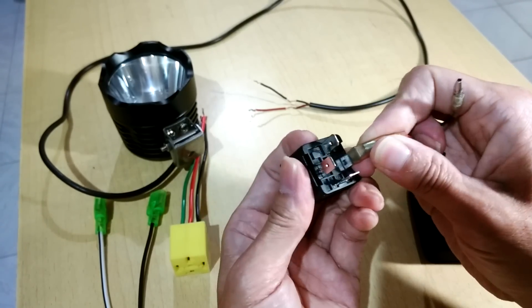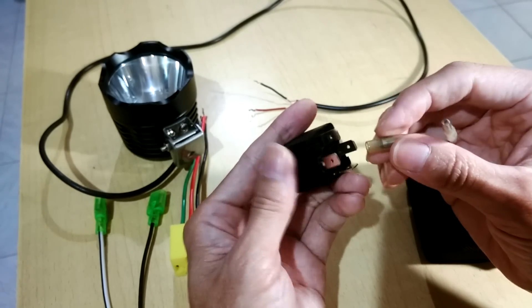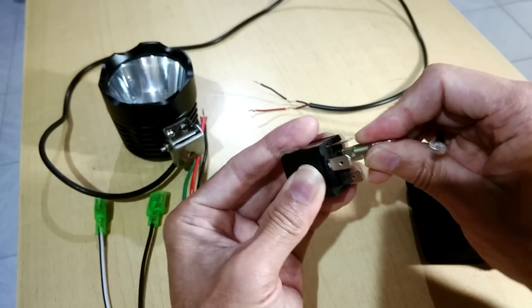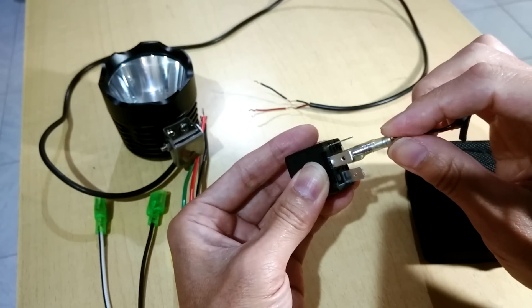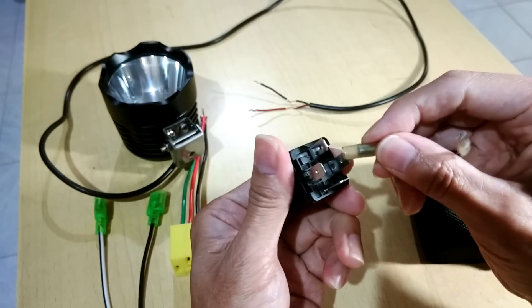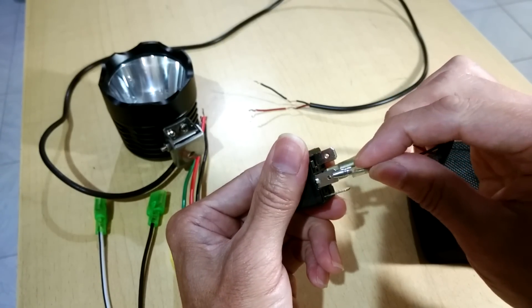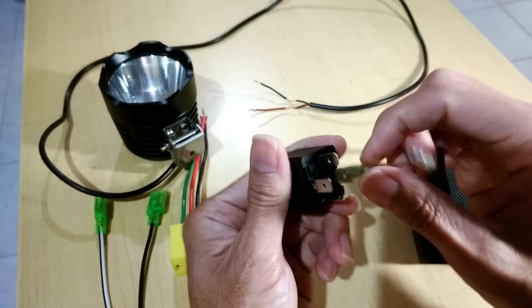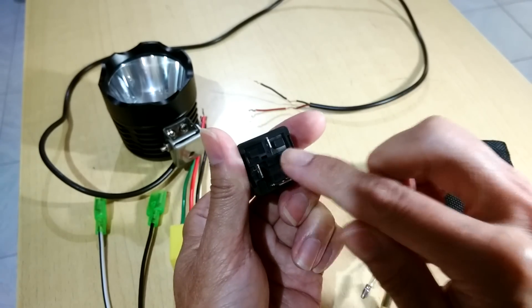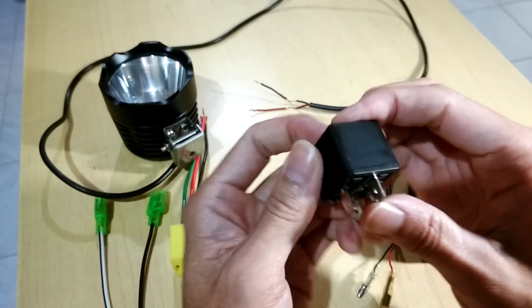As I said, the electromagnet is non-directional. So I can feed power to 85 and touch 86 with negative, or put power to 86 and touch 85 with negative — same result. When you hear the clicking sound when applying power to the first circuit pins 85 and 86, that means the relay is working, no problem at all.